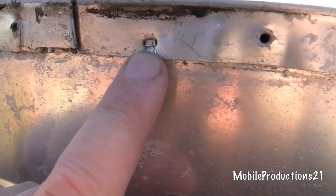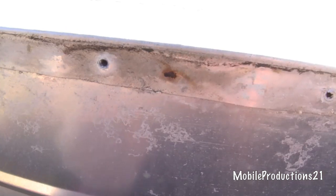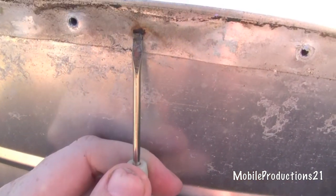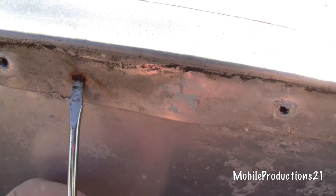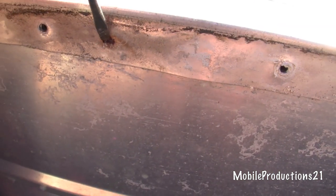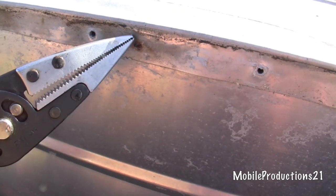This is a staple that I've removed. They staple it as well before they put the screws in — this one's corroded. I take a screwdriver that will fit underneath the staples and work it in, then hammer it up. Sometimes you have to go from the top too. Then you take needle nose pliers and just pull it out.